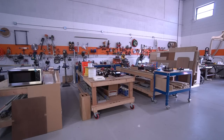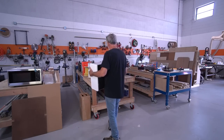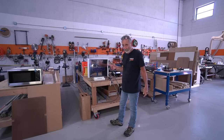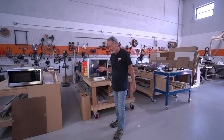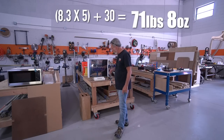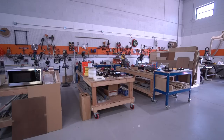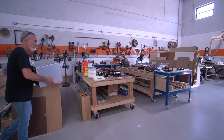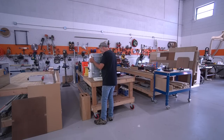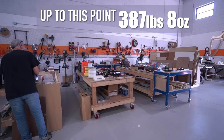The water tank — this is a five-gallon Webasto water tank, and it's empty right now. So we're going to add five times 8.3 pounds per gallon to the tank weight of 30 pounds — that's the overall weight when it's full and making your hot water, not to mention the lines that go up front to the heat exchanger. This little baby microwave is 25 pounds — you're adding all this up.